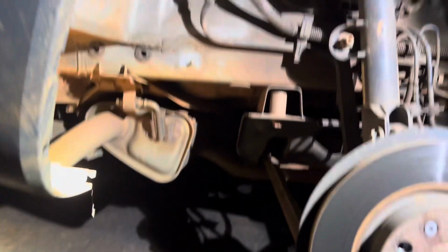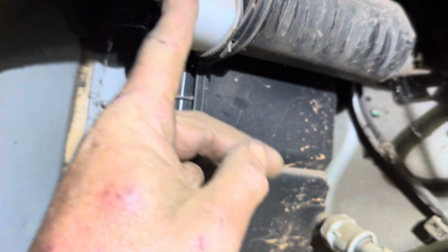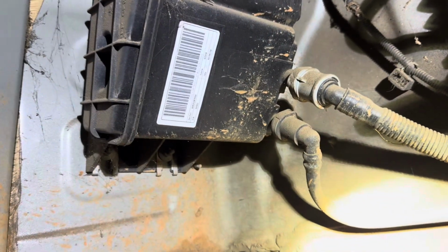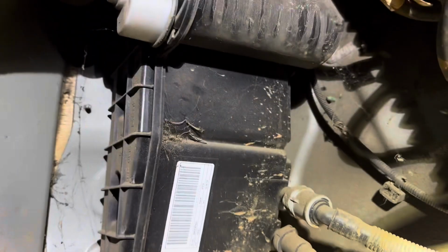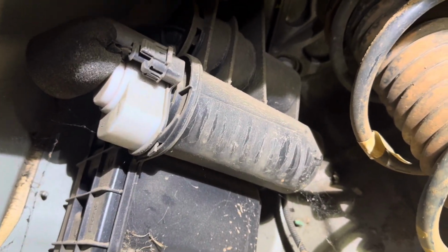All right, everybody. So now I've got the rear passenger side wheel removed. I've got the wheel liner removed. There's your filler neck, and then here's the filler neck coming into the car, going down into the tank. And then that's your EVAP tank. And typically what fails is this unit right here. This car has a 0455 and a 0456 as permanent codes. So this has to be fixed. Once it's set as a permanent code, it has to pass 3 test cycles before it'll clear the code.